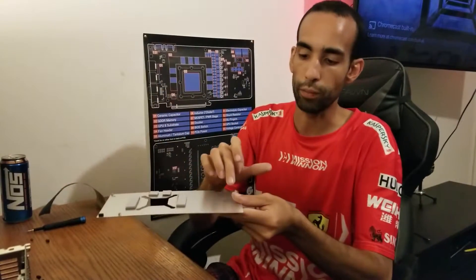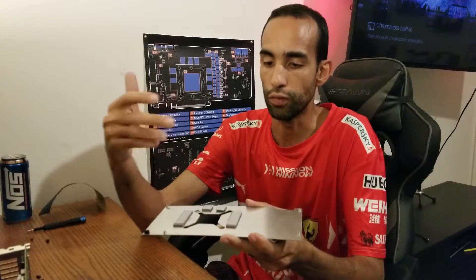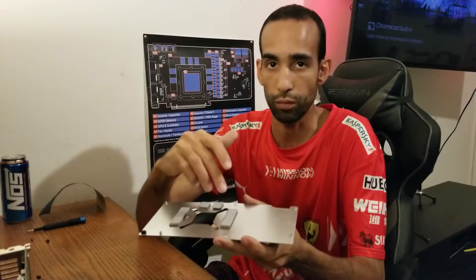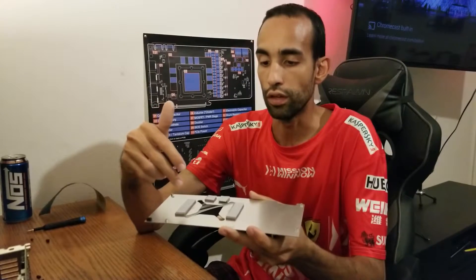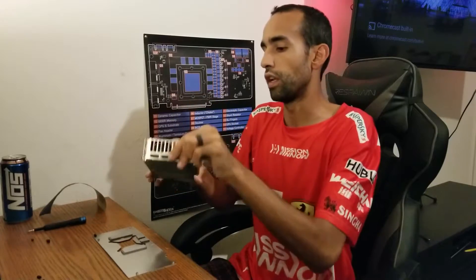I also noticed the back of the backplate was bowed out, so I tried sanding down the little mounting points with 400–800 grit sandpaper to get a little bit lower. Easy tactic — it's aluminum, so I put it over my knee and bent it slightly inward. We're going to see if that makes a better connection. You don't want to stack thermal pads because that won't help efficiency or thermal conductivity. Now with it slightly bent inward, I'm going to apply this back to the graphics card. I'll also need to reapply the liquid metal, then we'll look at the temps together.